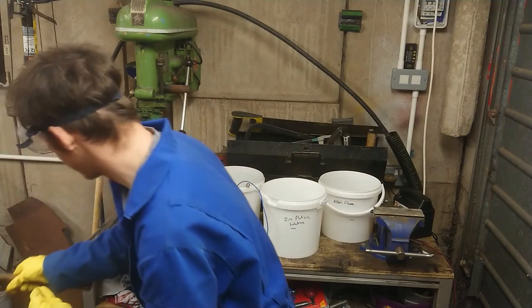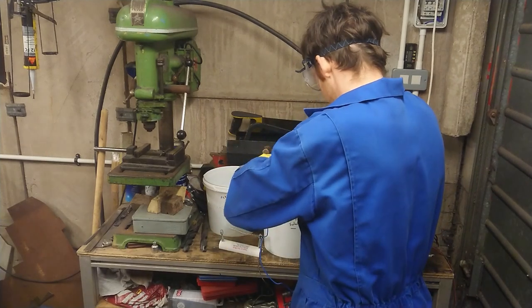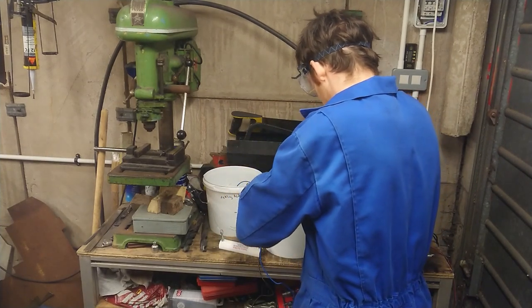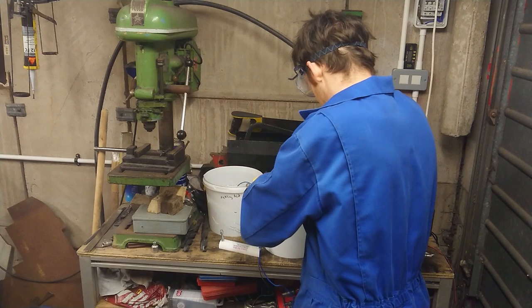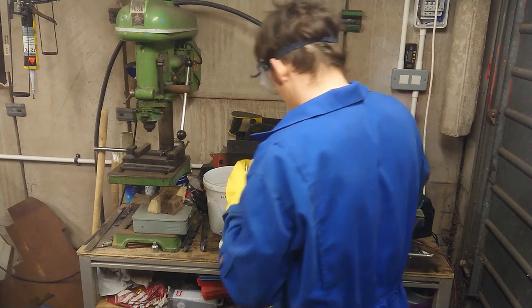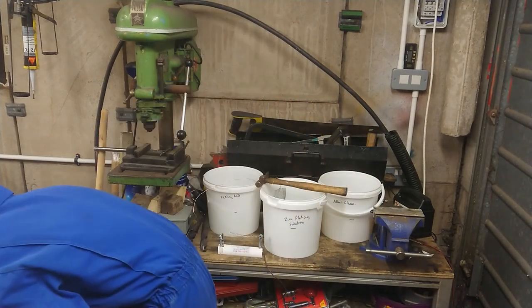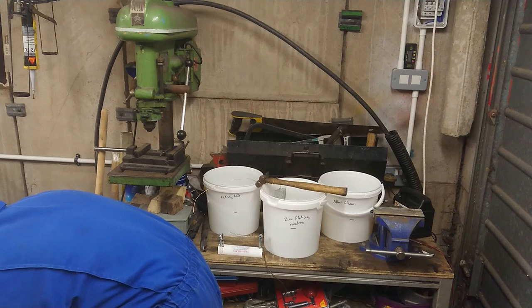With the parts put through their required acid pickle cycle, they were then rinsed off in distilled water before being moved onto the zinc plating solution. It's important to note that the anode and the cathode need cleaning as well, so as not to contaminate the plating solution. And finally, the parts were washed in the passivate chemical.